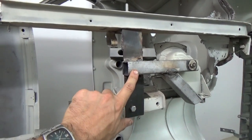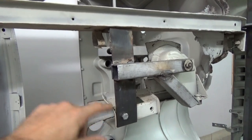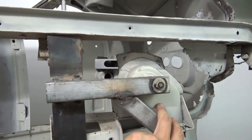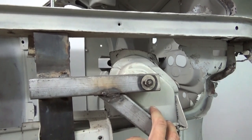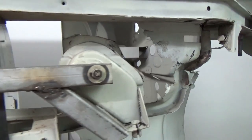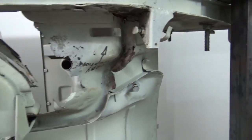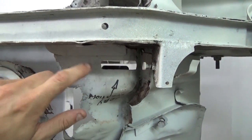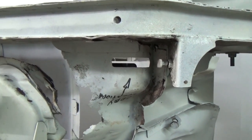Here we fabricated this jig and reinforcement panel. It holds together the gearbox mount with the chassis rail to the clutch pedal assembly. This part is welded to the floor pan so if we remove it we will lose all the location. With this jig we can hold the correct position when we weld it back on. This angle here helps it keep reference. We also made a cardboard template for this slot over here, as it's part of the old floor pan which the new floor pan doesn't have, so we need to mark and cut before we weld it in.